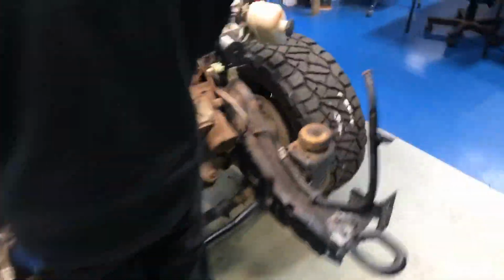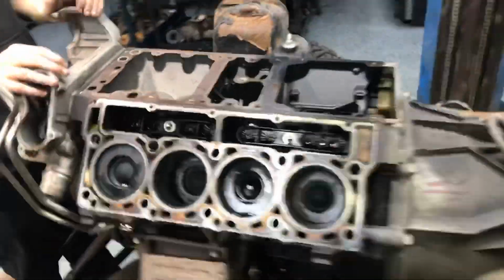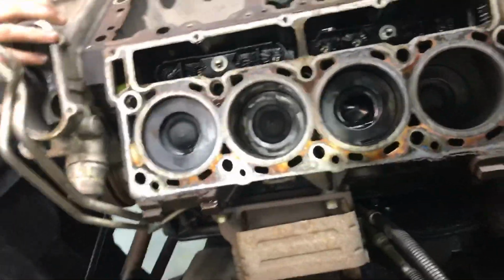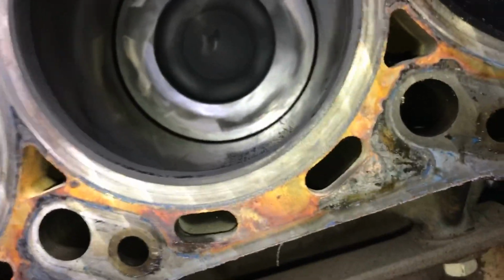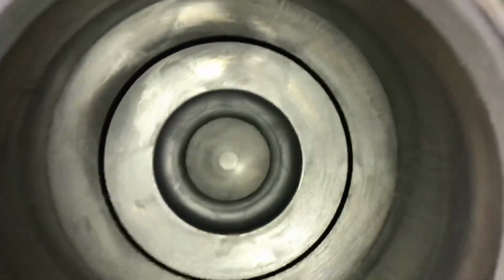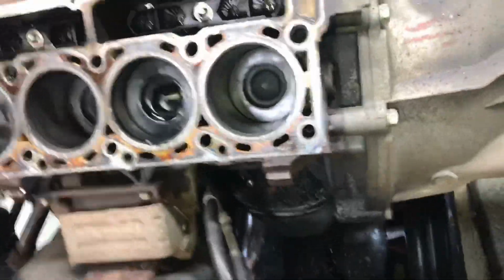you know, as far as rotation, I mean, honestly, if we do pull it apart, we'll just have to look at the bearings and check clearances there. We did wipe some of this off. This side looks pretty good. Did you wipe this off already? You did, didn't you? The cylinders. The pistons? Oh, no. They look pretty good. I mean, the pistons look pretty good. I think I shop vac it. I don't remember what else I did. I think I just shop vac them out when we pulled the heads off.